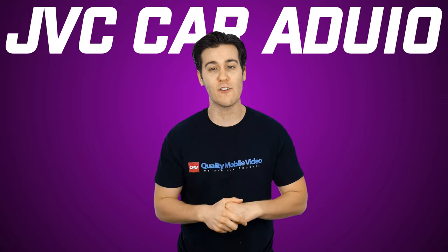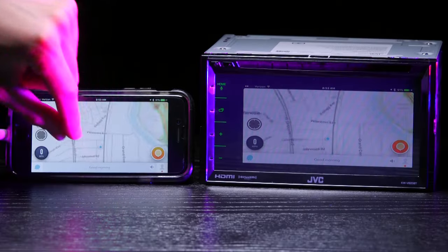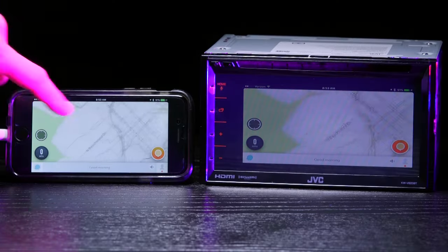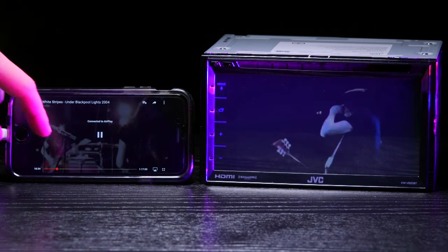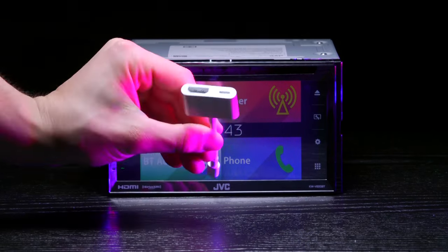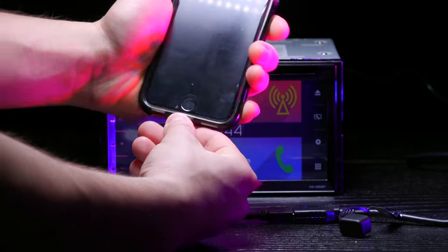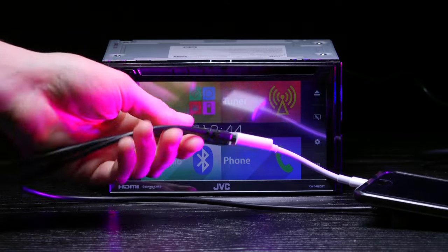Besides the skin layout, my favorite feature on the Chameleon is its HDMI input, which allows mirror link. This adds additional functions for non-native apps. Android users must use an MHL HDMI. To utilize it and create the mirror link, we use the Lightning Digital AV Adapter. This cable connects to your phone with a lightning cable, which connects to an HDMI cable, which connects to the Chameleon.